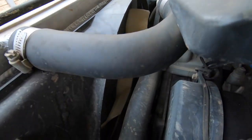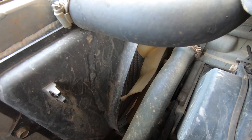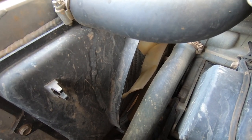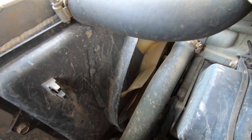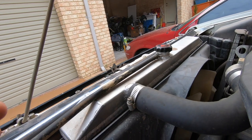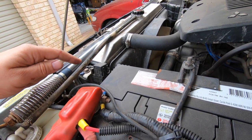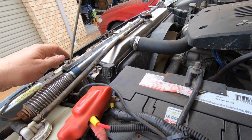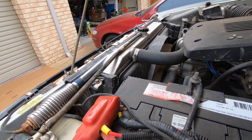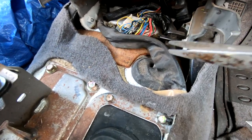The last and very important thing: when you're lifting the body, the radiator comes up with the body, which means the fan shroud comes up with the body, but the fan is on the engine so the fan stays there. You need to modify the fan shroud — don't take it off, it works way better with it on, but we will have to modify it. If you're really keen you can actually relocate the radiator lower, obviously that would be the best thing to do, but it's just way more work. When I've done body lift before I've managed to get away without doing that without any dramas.